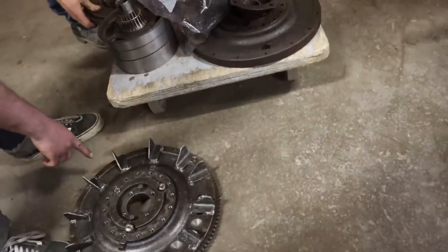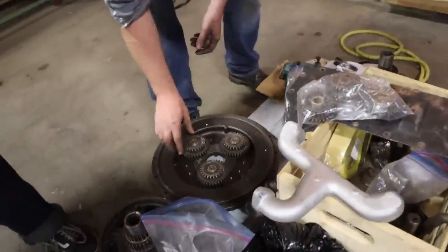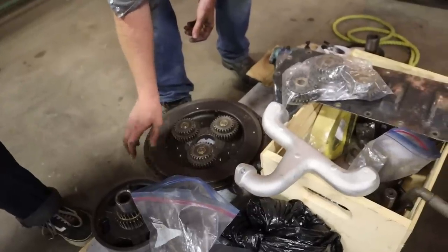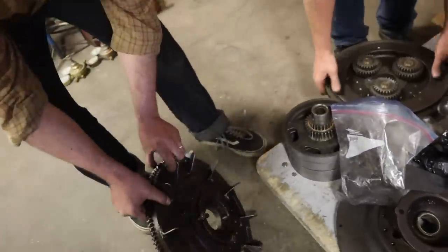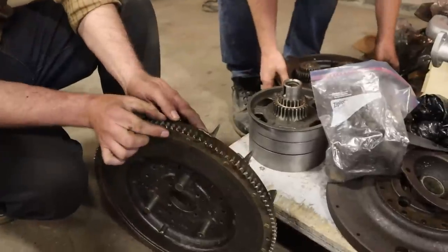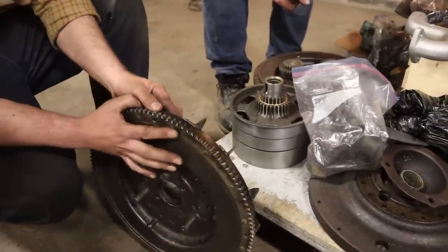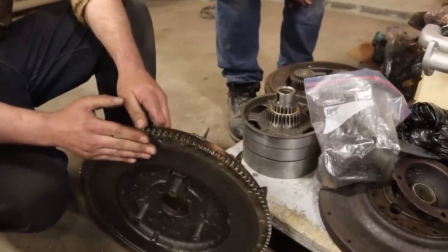Yeah. But so from your good buddy here, you've got rebushed triple gears here. Okay. Yep. On this flywheel, but we figured since I've seen you use your electric start too, you probably want that. Yeah, probably. So these brass bolts, which we have new ones, go through the ring gear. So we'll have to easy out them, grind this smooth, easy out them, and then pull each bolt out to get the ring gear off because I don't have another ring gear.